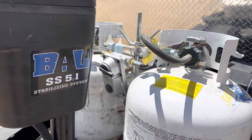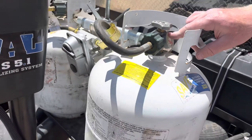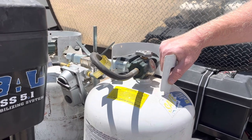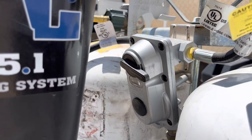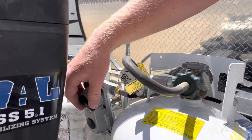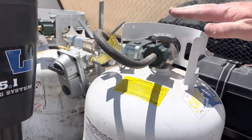On your unit, you have propane in the front. As you can see, they have gauges on them. We ask that you bring these back full. We ask that you do not exchange our bottles — as these have gauges, the ones you exchange will not have a gauge, and you don't want to pay $100 to replace our tank. To use the propane, look at the little arrow — whichever way it's pointing is which tank is being used. Once one runs out, turn it off, flip the arrow over to the other one, and turn that tank on. It might take a second to bleed the lines during the switchover.